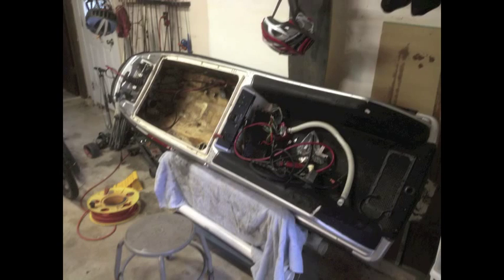The first step is to remove everything you can from the engine bay or inside the ski. Here's a shot of my ski with the engine, e-box, coupler shaft, fuel tank, water box, and handle pole all removed. You could get away without removing the handle pole, but it makes life a lot easier if you do. Basically you want to take everything out that you can so you can get in there easier and get around. I also use lots of Ziploc bags and Tupperware containers to keep track of all my little bits.